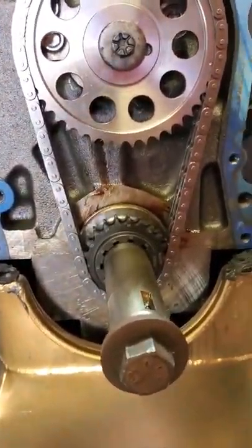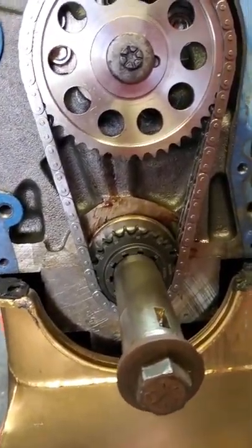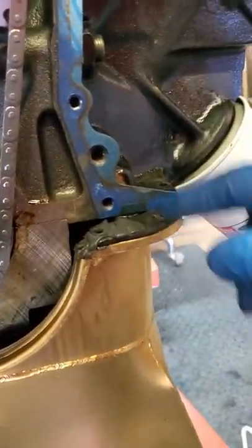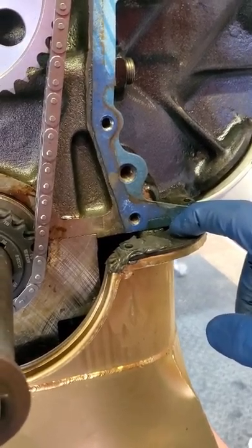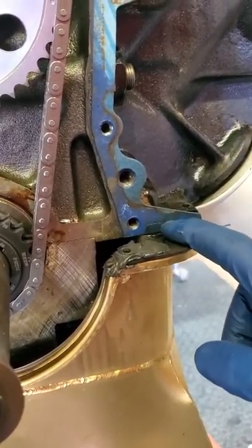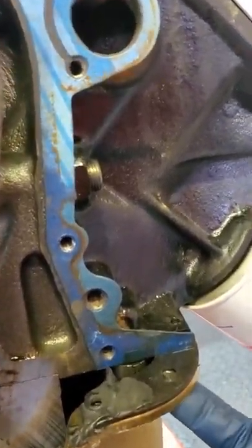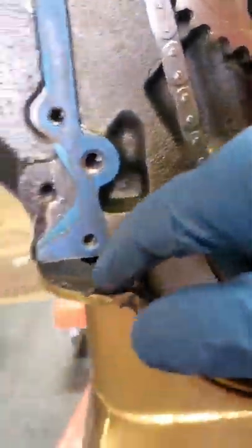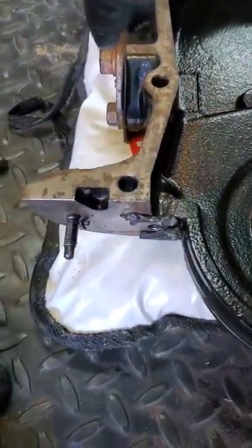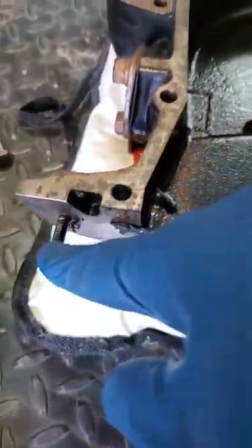At this point I'm going to drop this pan as well. It's the studs that caused a little problem up here — if you ever wanted to pull the timing chain cover or water pump without having to pull the pan, it would be very difficult when there are studs used. You can see the studs on this timing chain cover — there, there, and there.